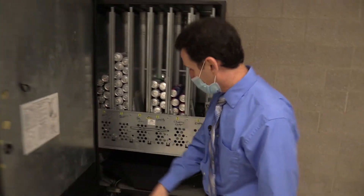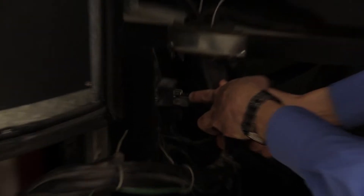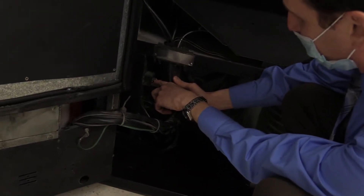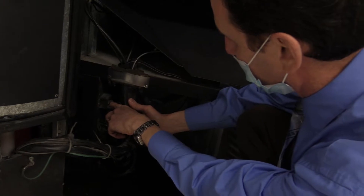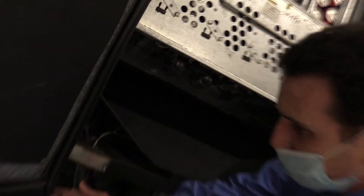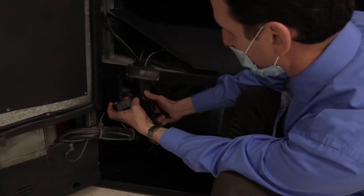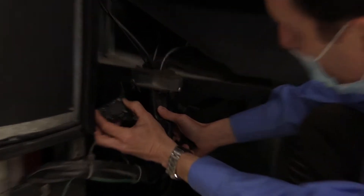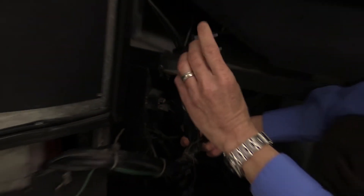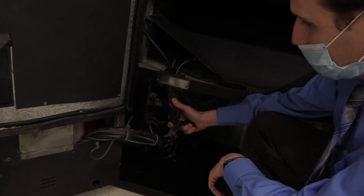The compressor relay is down here at the bottom of the machine. You can see this whole relay brick right here — that's the relay that turns on and off the compressor. Most of the G3 machines do not have the add-on to turn on and off the evaporator fan, so that fan is always running and nothing's connected to that. But we do have the connections going to the compressor. I always keep a backup relay in case one of these goes bad — you always want to have an extra of the relays that your machine needs.